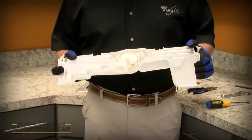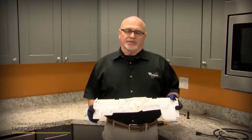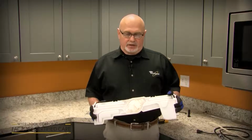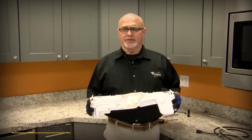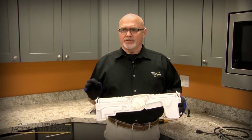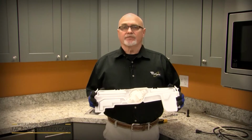And that install service cycle is a real quick key dance: 1, 2, 3, 1, 2, 3, 1, 2, 3. If you're successful, all the LEDs will come on, and then you can rapid advance it steps 1 through 6. Step 1 is drain, step 2 is fill, step 3 is wash. And like I say, it's a short 5-minute cycle, or you can rapid advance it to whatever portion of the cycle that you want. And just to make sure we're doing this so you check for leaks.